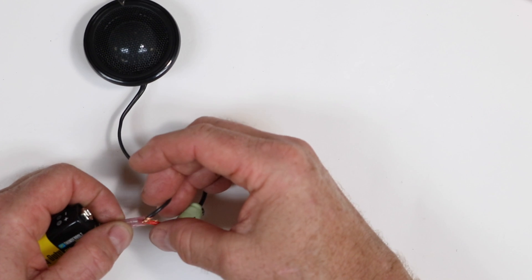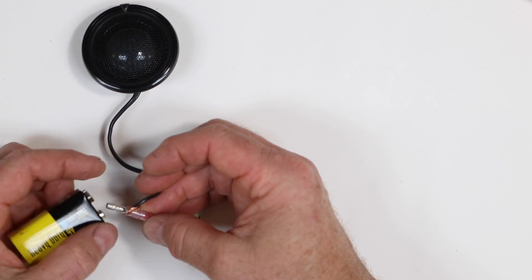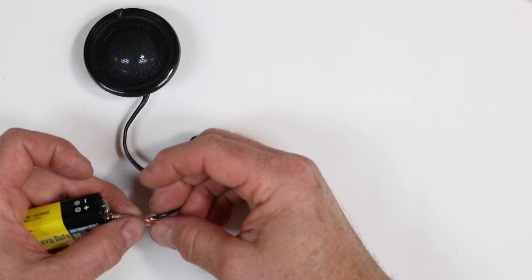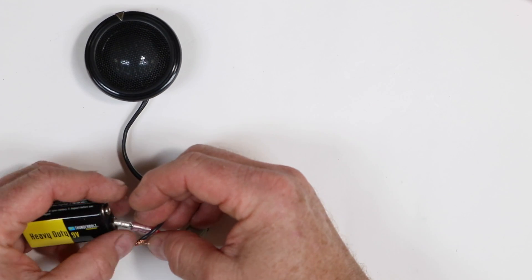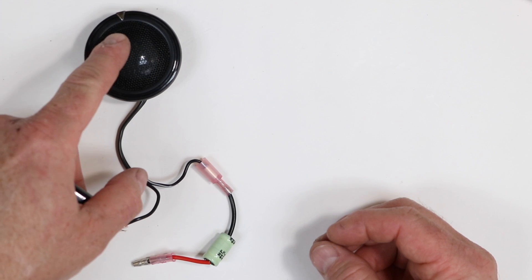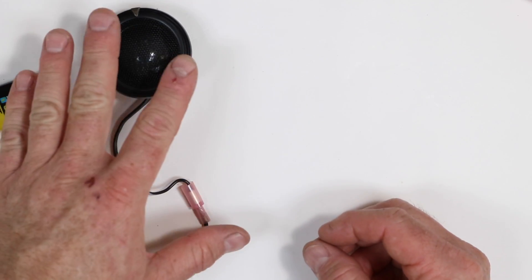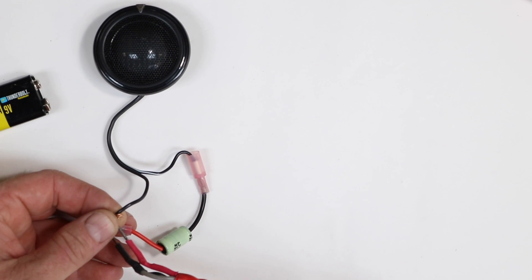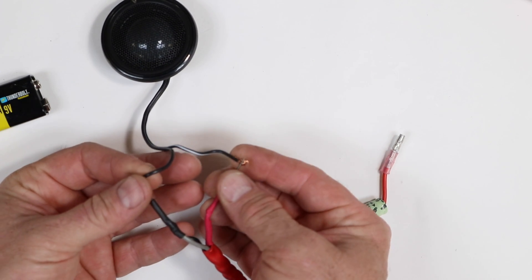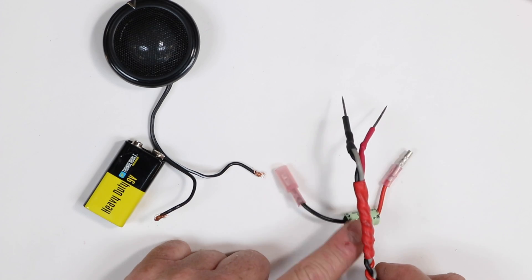If you notice, you just heard that one tick. Now if you flip positive and negative from the battery on the wires, you'll hear the tick again. If you flip the battery again, you'll notice that if you keep tapping it, it's not going to keep making that tick sound — that was actually the discharge. So we'll go like this, then we'll go here, and it discharges. This is going to tell us if that factory tweeter has any form of bass blocker in line. So if you're going to do that amplifier bypass and you run your tone generator through it, it sounds no different — so that's where popping the speaker with the 9-volt will let you know if it has any form of bass blockage.